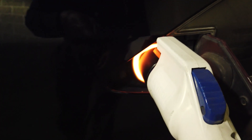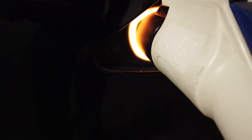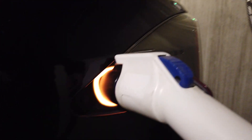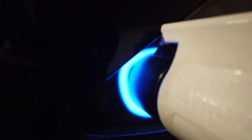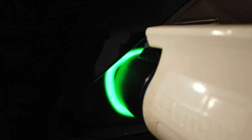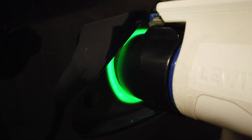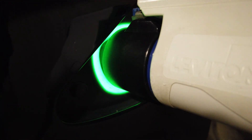Here I am at where I work. Since they have EV charging here and I have often charged here in the past, let's go ahead and test this out and see how well the adapter works here. It's getting an orange error. Over here it does say it is charging, so let me try taking that out and putting it in again. Maybe I didn't push it far enough because it's so stiff. Now it's just blue — now it's green. Because this adapter is so stiff, you definitely have to push extra carefully and make sure it's getting full contact inside. Otherwise it doesn't work. But it is working.